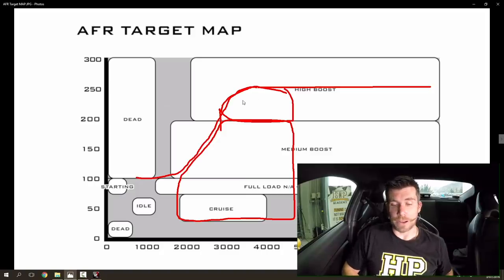While the engine's only going to transition through these areas very briefly, we still can't ignore them. The procedure for tuning these areas is to simply interpolate the values found under wide open throttle down to the area tuned in steady state — around about 200 kPa. We can also use the interpolation function to help fill out the volumetric efficiency or ignition table values in areas we haven't tuned. Now while I recommended increasing boost pressure in 20 kPa increments to completely fill and accurately tune both our fuel and ignition tables, there's no strict requirement that you must do this.